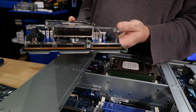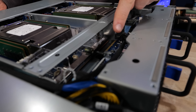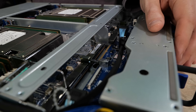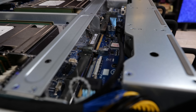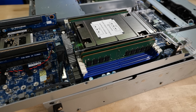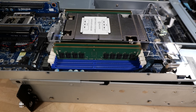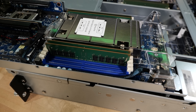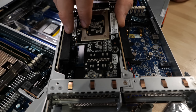If you're doing something where your jobs can be split up a little easier in software and the job can live local and doesn't really need to get at the memory or anything else in other nodes, you can have a setup like this — where this is a standalone computer in this form factor, and you've got access to the memory here, up to two terabytes, but really as a practical matter, 512 gigabytes to one terabyte, I would say. And you've got your X16 slots here for IO.